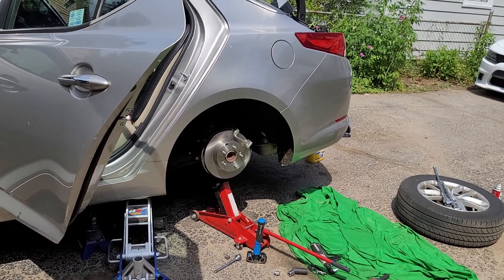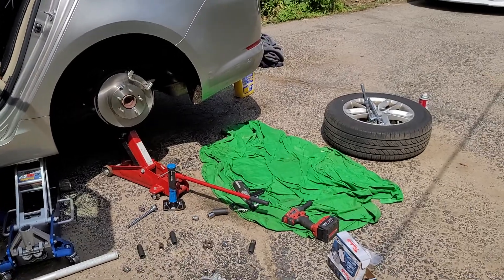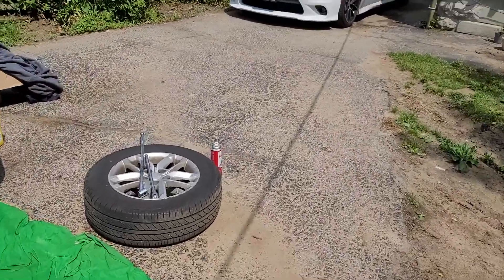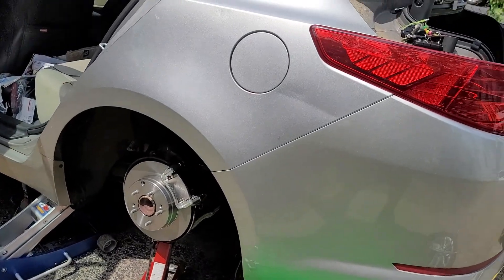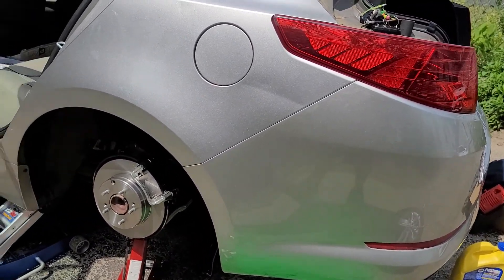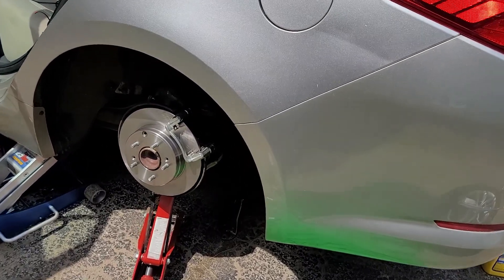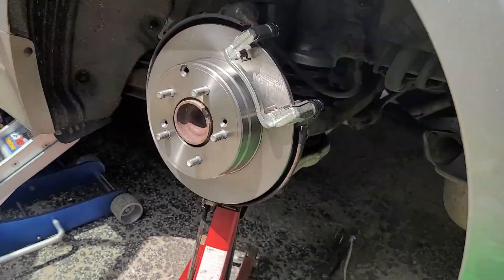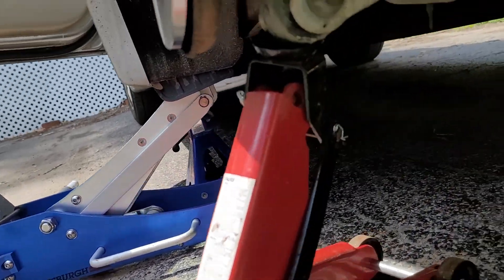Here's the thing. What they don't tell you is when you want to put the rear control arm back in — they say you got to hammer it back into place, and hammer it out when you take it off. That is not true. What you have to do is release the tension on it.